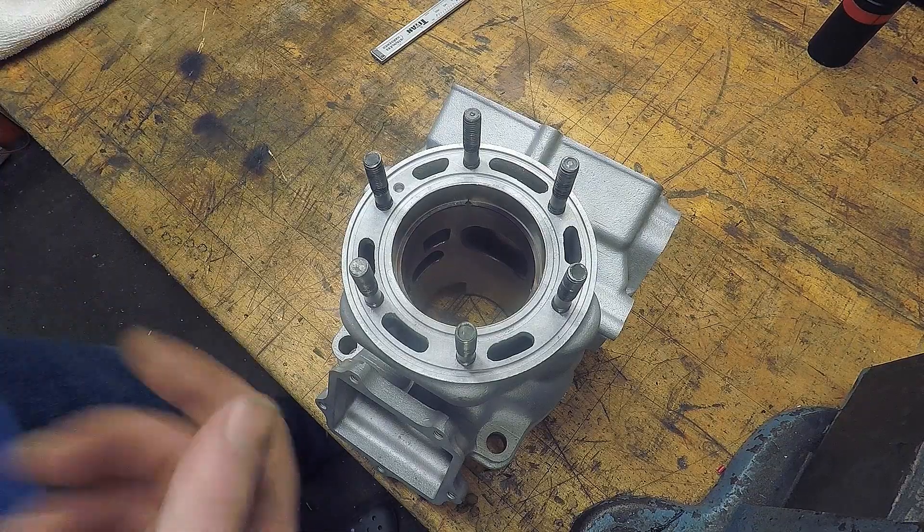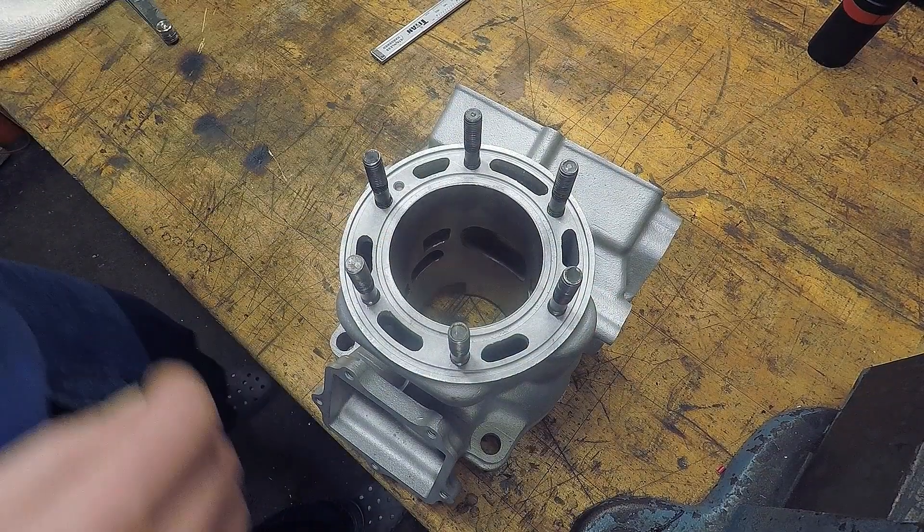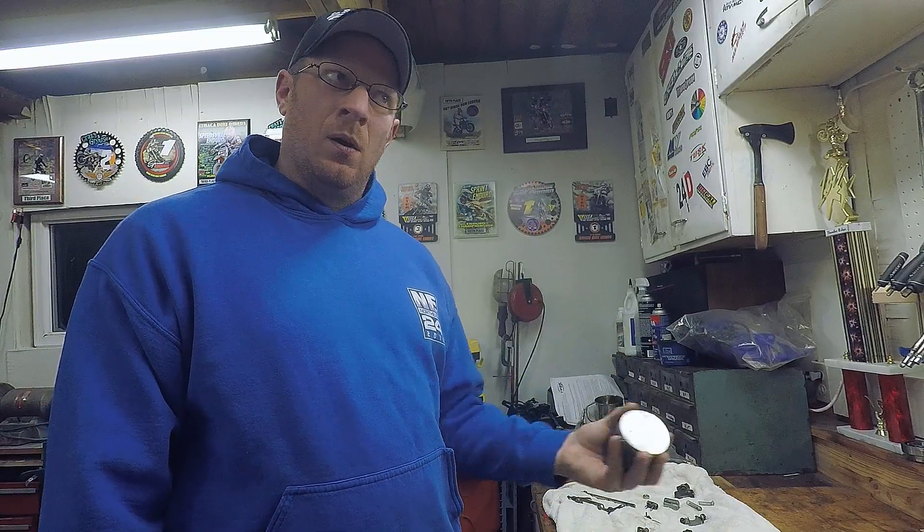This one's 0.021, which I think is a little wide, but I don't need to remove any material. This one's 0.020, so I'll put this one on top. Both piston rings measure between 0.020 and 0.021 inches — well within spec on the high side, but definitely in spec. My limit is 0.037 so I have plenty of room. The piston-to-wall clearance is exactly 0.0020 inches.